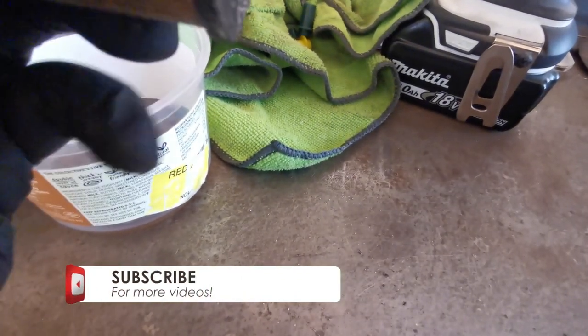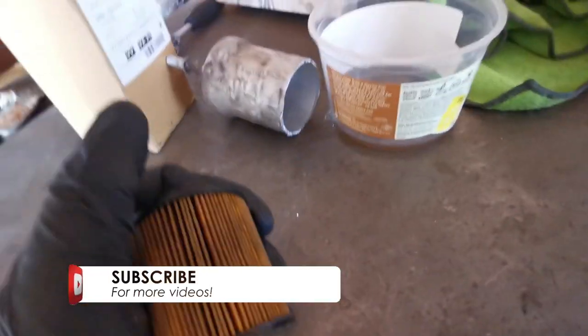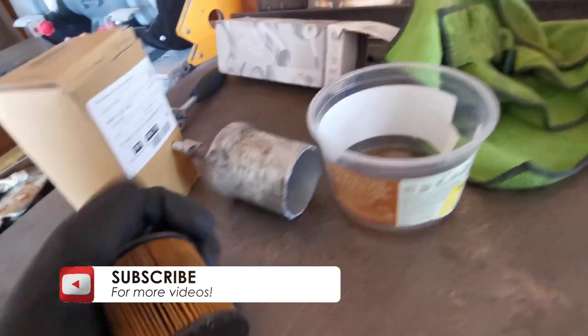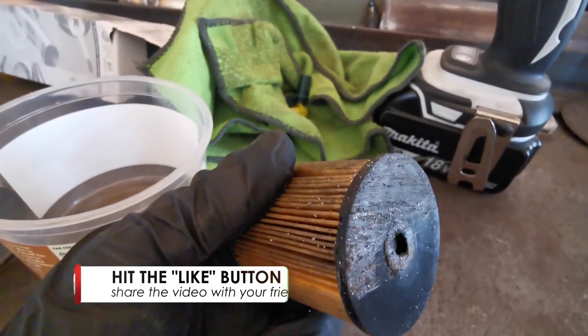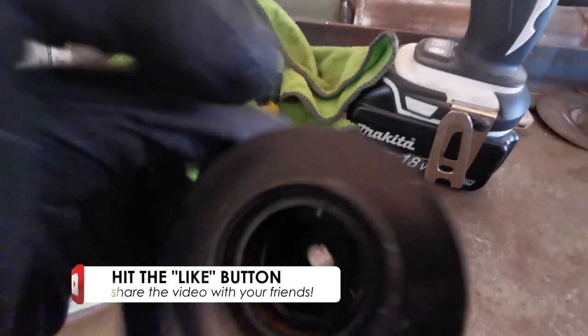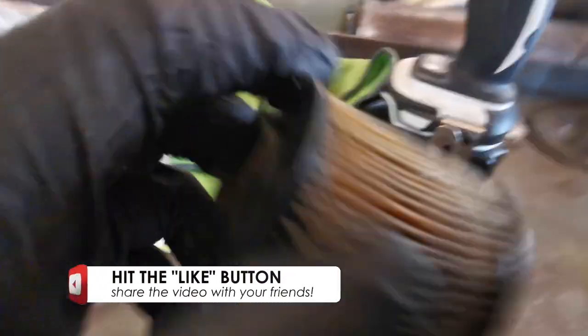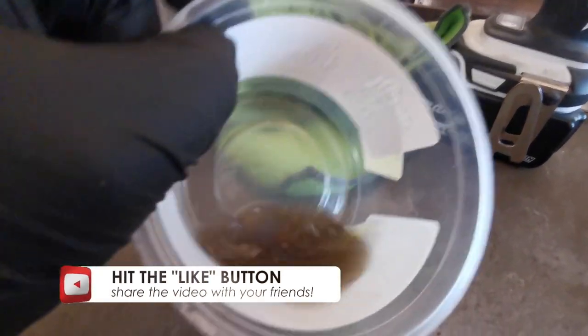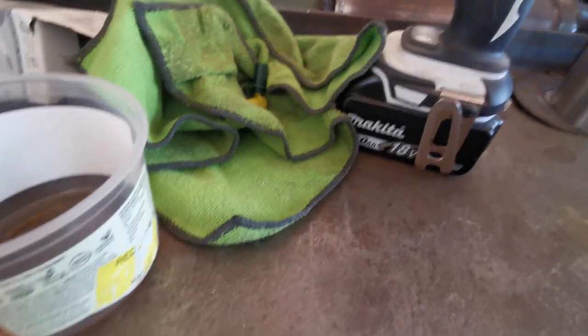Fuel flows through this and then back round and then comes back through. So what happens is this sits inside of that little chamber. The fuel comes in at the top and it filters through this basket into the centre, which then comes out this side, which is your outlet. So it filters all the crap through the outside here, so the inside is probably fairly clean. But it is still a very dirty filter. I'm glad we changed it, especially considering the colour of the fuel that came out. So hopefully we should see a bit better running.